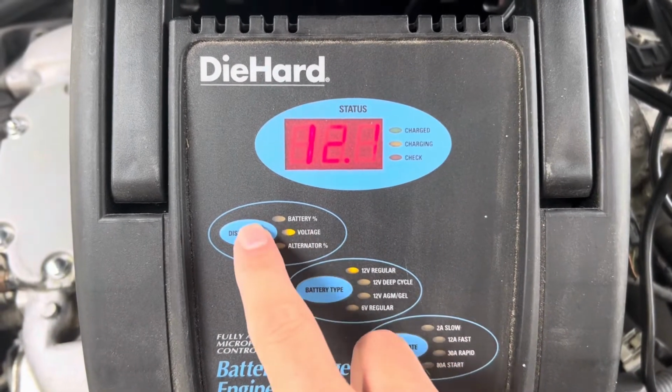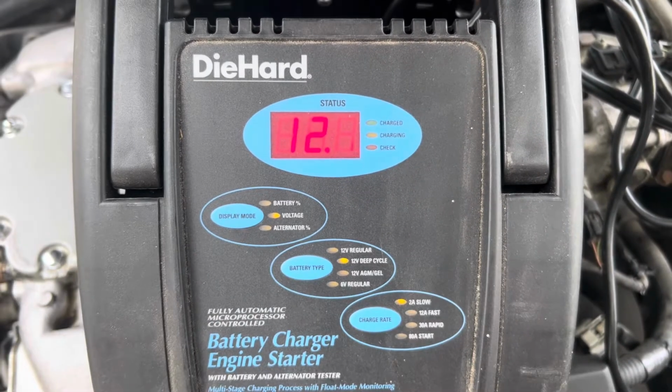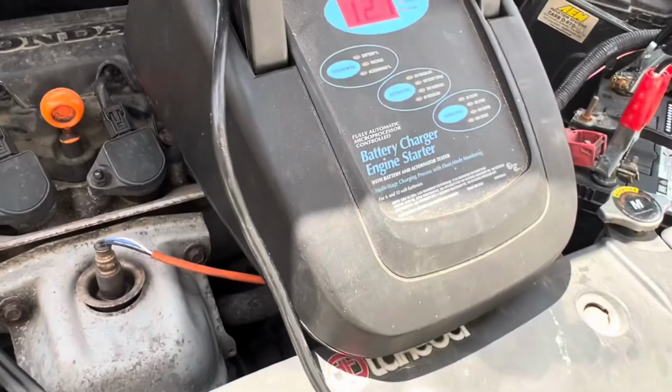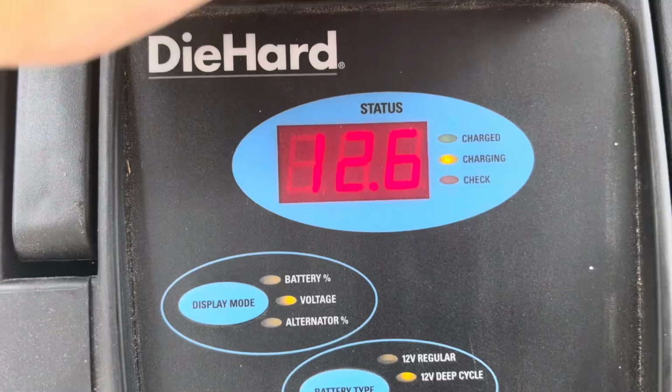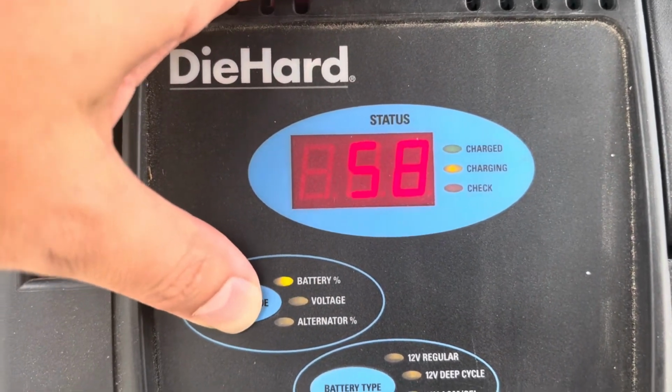To fully charge a battery, I recommend a microprocessor controlled charger that I will also link below as they're safer, quicker, and have a more effective charge. Most have protection built in to avoid overcharging while maintaining the charge. The percentage and voltage feature built in helps monitor the charge. The safest and most effective is with the lowest 2 amp setting.